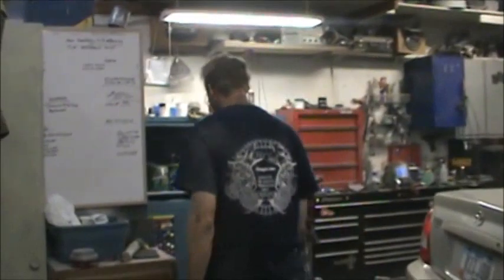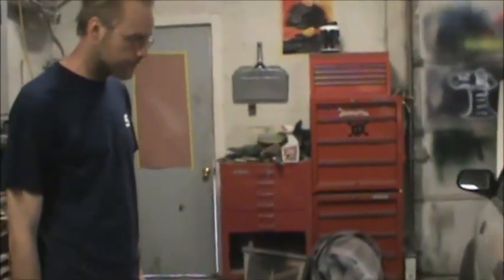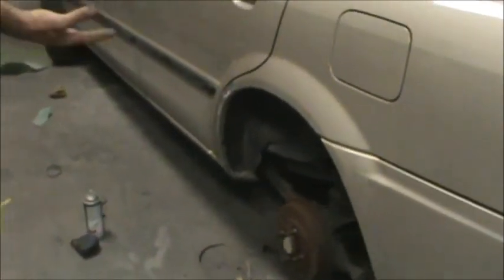Over here, I'll show you where we're at. We've got the door gap good, down up underneath. The bottom side is going to be a little crooked because I lap welded it, but it's not going to hurt us any — you'll never see it. It's got that texture coating on there. All that's seam sealed in there where we've nicked and cut and everything else. We'll throw fiberglass over the weld — just a little dip right here — and we'll take care of it with the fiberglass.